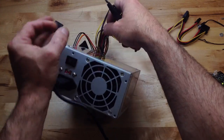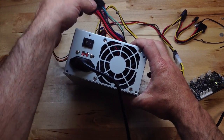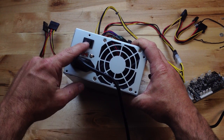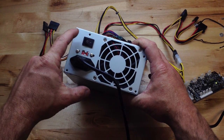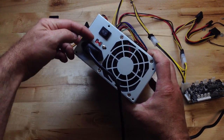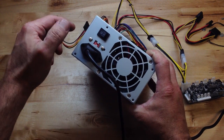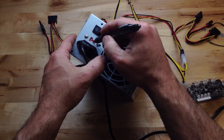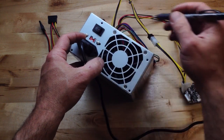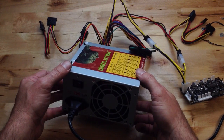You can tape that up or however you want to handle it. Now I can just set that aside and my power button works. By the way, if you're international, you're going to want to switch this — it's a switching power supply. If you're in the US, don't even touch it. 115 is proper for the US, and the other setting is for European customers and those abroad.